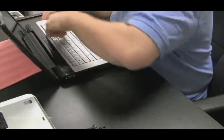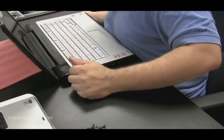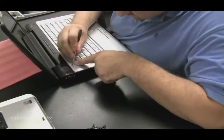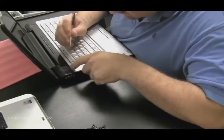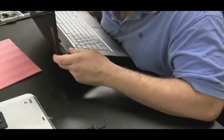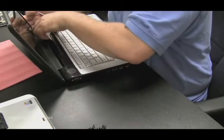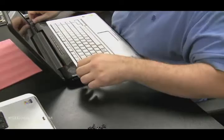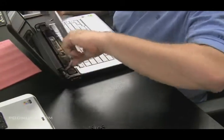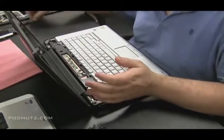The first thing I'm going to do is get that hinge cover plate off — it's different on every laptop, and some laptops don't even have one. But this is the key to getting the keyboard and the screen off, which is what we want. Gently put some pressure on the sides and pull it up. Since we have all the screws out from the bottom, there are no screws holding this plate in — just pop it up.